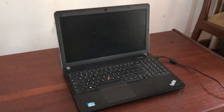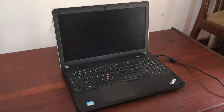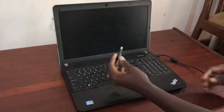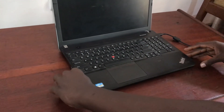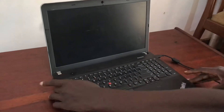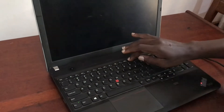Hello YouTubers, this is EduDancers Uganda. I'm going to show you how to USB boot your Lenovo ThinkPad Edge. This is our USB cable containing Windows 8.1. Make sure you put the USB into your computer, then tap the power button and tap F12 continuously.